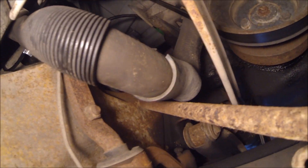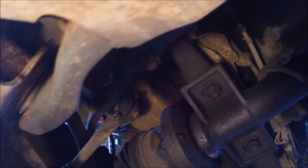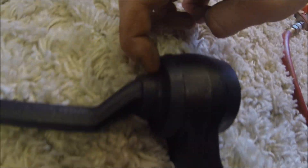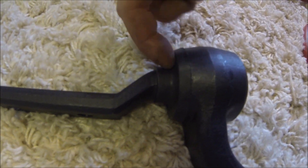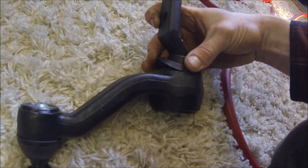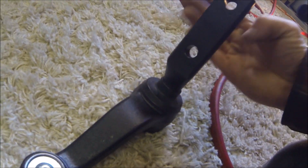This is the arm here that we're gonna be changing. It was just two bolts there, and it's held on with a cotter pin down there. We looked at it and all the slop is right in this joint here — from the bracket at the frame — so it makes sense that the idler arm is shot.